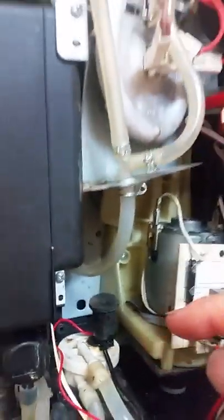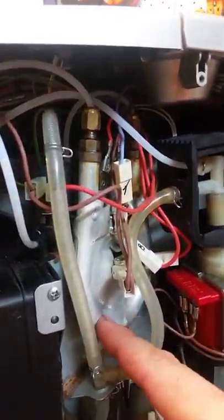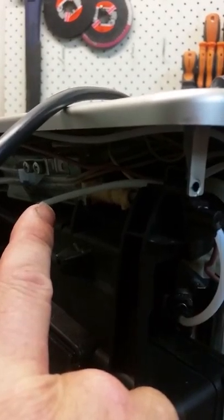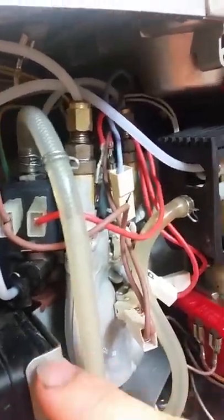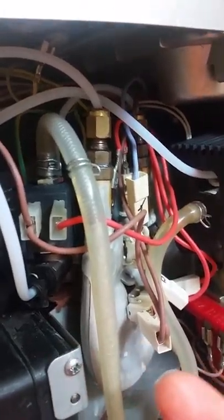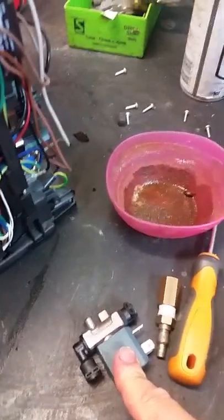So at the end of the day it was a flow meter — there was talk about solenoids. This machine has got two boilers and two solenoids. Here is what I think is the vaporizer, the milk-steaming boiler; up there is the main boiler for the coffee. Here is one solenoid — one screw here, another screw, follow the plate around and there's another screw at the back. Two screws come up from underneath to hold that solenoid on, and just two wires come off. So it can come off easy.